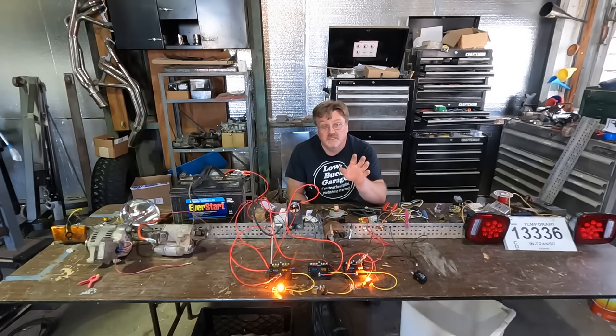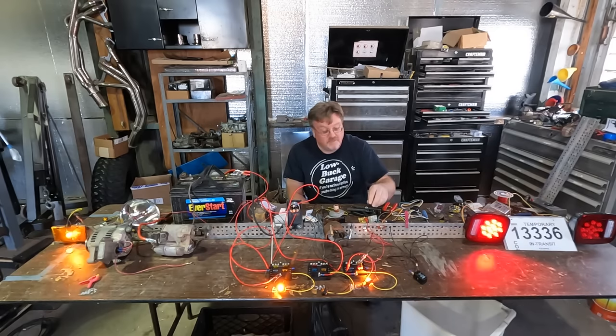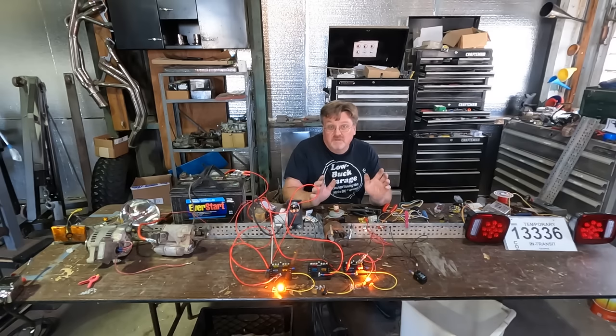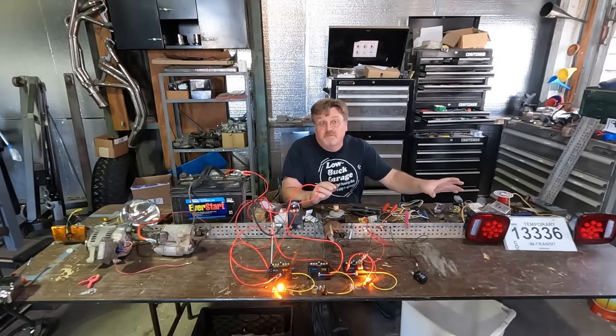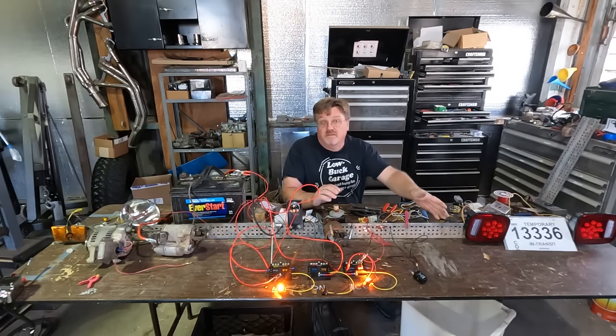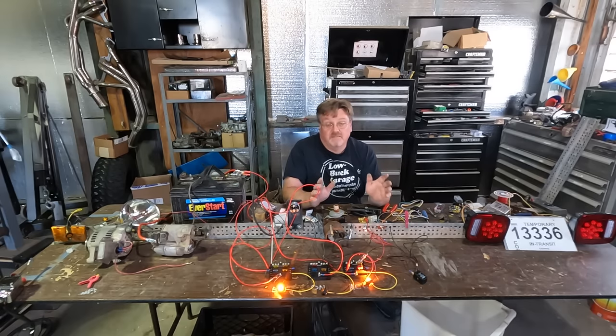There is one thing to note — if you are signaling and then hit the brakes, the brake lights take over. Personally, the most important thing I want taillights to do is keep people from rear-ending me, so people knowing I'm stopping is the priority. In most OEM systems though, the signal light cancels out the brake light. For your absolute safest option, run separate turn signal lights and don't try to run them through the same bulb — brake lights to one light, signal lights to another. But that means adding separate lights. A lot of vehicles have only two taillights and you're stuck, but there's a solution for that too.